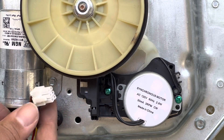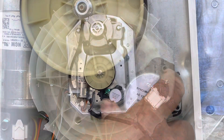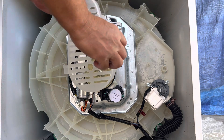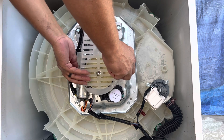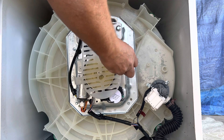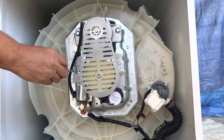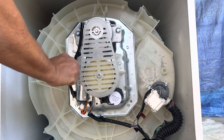Check to see if it's nice and tight. Now reconnect the connector to the shifter — slide it in and make sure it's tight. Now we're gonna replace the belt guard back onto the washer. You're gonna need the 5/16 nut driver — two screws, one on the right and one on the left. Tighten them up with the 5/16 — really easy. Now the belt is guarded.